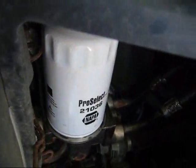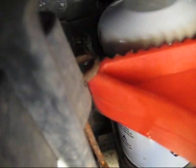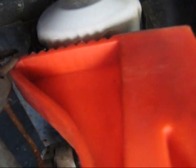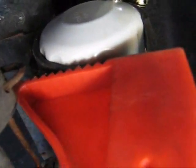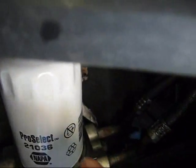It's not required, but just to show you how this strap wrench works — you put it around the filter and you would just snug it up a little bit. It's a little tight in here because of that trap door, and I'm hitting the spring on the door. These filters will crush, so I'm comfortable using this strap wrench to just give it that little extra snug — it's supposed to be hand tightened. There's a little oil dripping; there's no oil in the engine yet. After you put the plug back in and fill it with oil, you run it for a while and want to make sure you don't have any drips underneath.